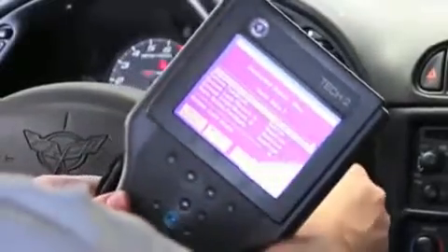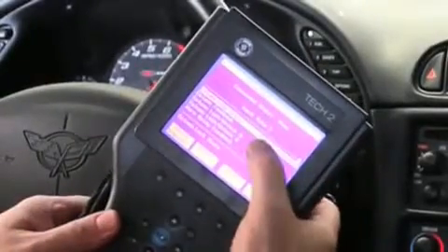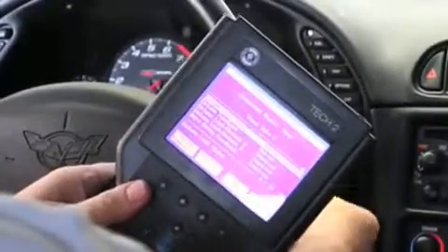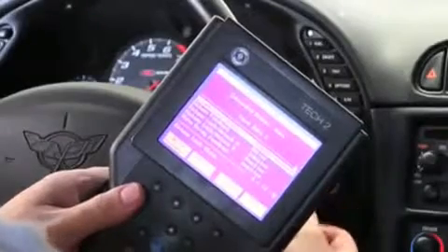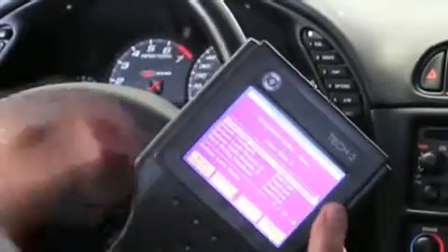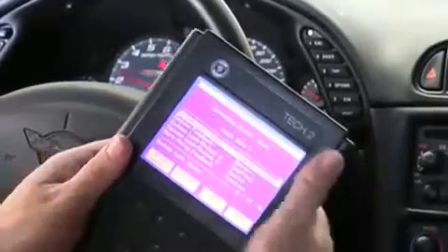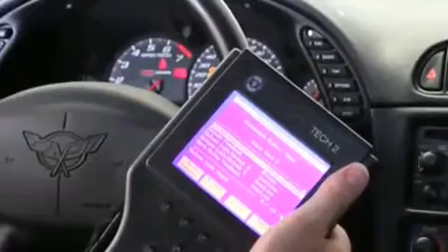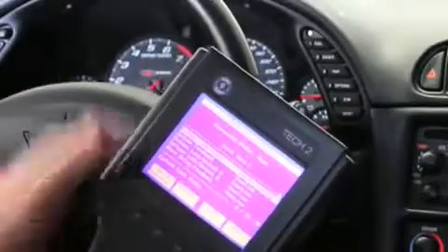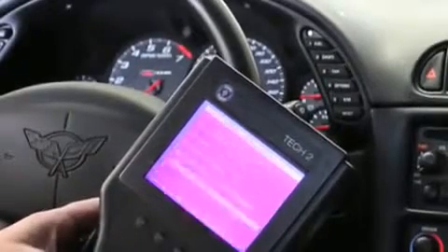So I'm going to cycle the key off just to observe normal operation. Turn the key off — you see it says off, unlocked. Column feedback is active, it's still unlocked. As soon as I pull the key out, you're going to see key out state. And you heard the actuator work — now it says ignition off, locked, and the wheel is now locked. Key on — actuator works. Key out — you heard that activity, and now we're back in business. So that's basically it. Thank you.